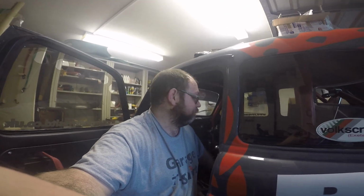I don't have a sheet metal brake, so that's 1mm steel sheet that I've had to bend just sort of freehand, which is why it's a really horrible, ugly shape. But I needed to do that just so I've got something that I can bolt the handbrake into, so I can actually make sure that the whole thing is going to work.